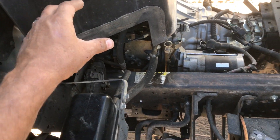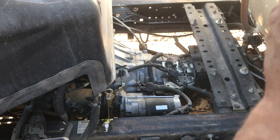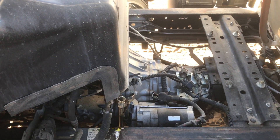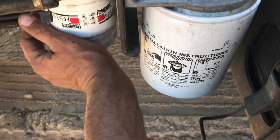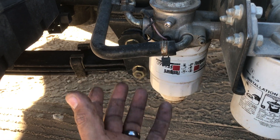So I'm thinking injector, I'm thinking the line to the filter, the line from the filter to the tank, or something in the tank. Is there a sock in the tank? No, but there are fittings that can rust and get into the lines. Everything was cleared out. We put a brand new Isuzu replacement filter on it. Everything's good to go, but it was still doing it.